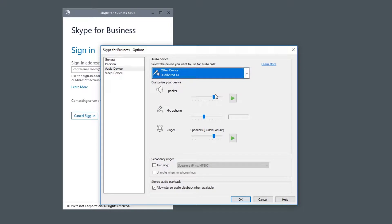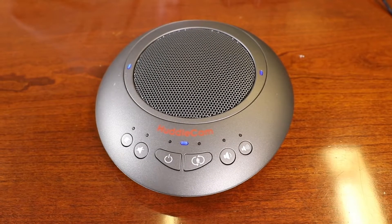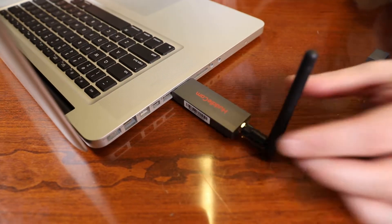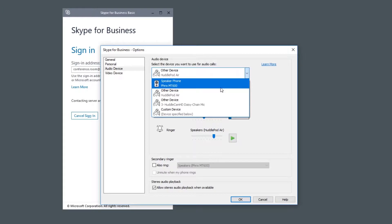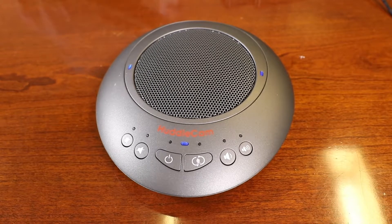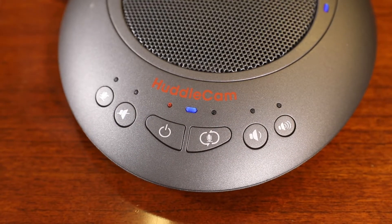Let's open Skype and try it out. Press and hold the power button until the device is turned on and enters standby mode. In this state, the bottom right blue light blinks continuously, waiting for a receiver to be connected. When the USB wireless adapter is connected to the USB port on the computer, the USB driver will be automatically recognized. The triangular blue light will now stop blinking and stay on, suggesting a successful wireless connection between the device and the computer.